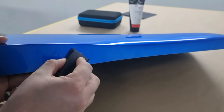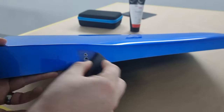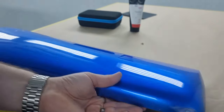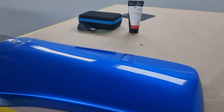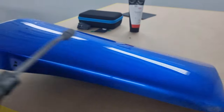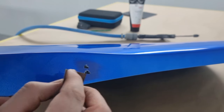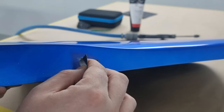I've got 320 on a nice flat block just to make sure that the edges of this chip gouge are flat - it's quite a deep one, gone right down to the plastic. We just want to make sure the edges are flat so that when we apply the putties it will remain smooth throughout. I'm just taking a high pressure blow to make sure there's no grit left from the sanding, because if you put putty on top of dust and it pops out, that's going to be the reason.